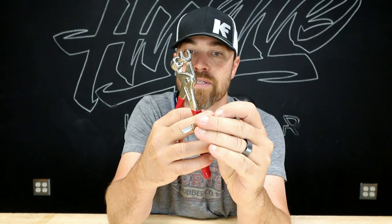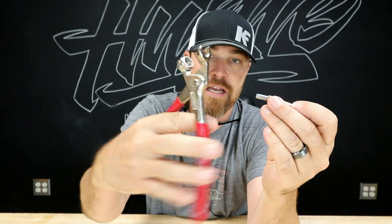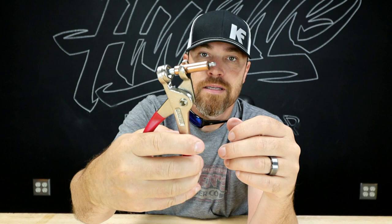How does that work? It's got a spring in here, and you've got a special pair of pliers. When you squeeze it, it takes these two arms that have little barbs on them and pushes them out. When it pushes them out, they come together, which makes them small enough to fit through that hole. Then when you release the spring, they spread back out. Those barbs actually grab onto the bottom side of that sheet metal and squeeze it all together.